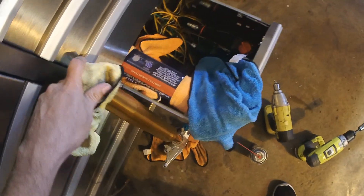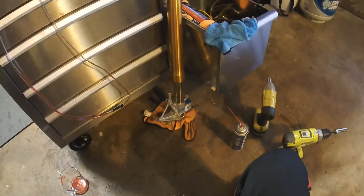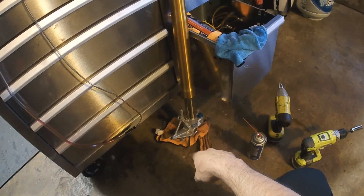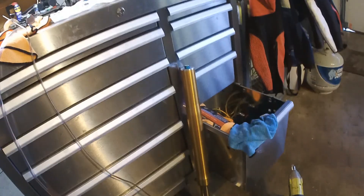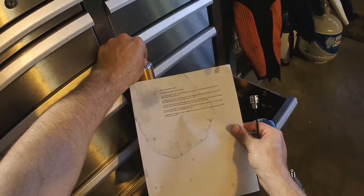So that should be about it — less than one Boom Crash Opera album. I've got the other one draining and I'll finish up with that one and then reinstall. The key issues have all been covered: removing the seal, removing the oil seal, replacing the oil seal, replacing the dust cover seal, setting the oil height. Spring preload I'll do in the bike because it requires this to be turned 8.5 turns in. Rebound — set it all the way in and then count out 12.